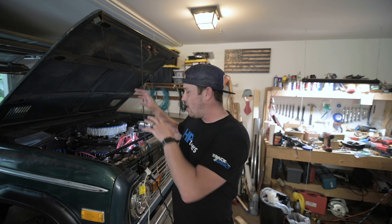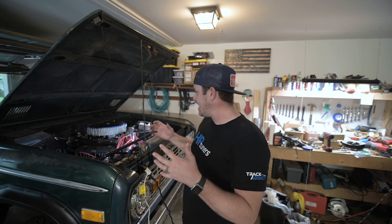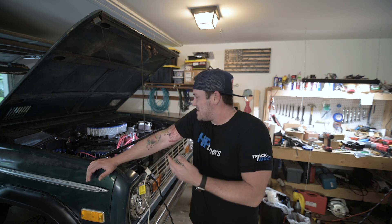There are a couple of interesting things going on. One thing I can't control with the fan shroud is that I'm blocking airflow on the passenger side — those headers aren't getting any air, likely because my heater hoses are blocking the airflow that should be moving past there. That's something to fix, but the fan shroud won't help that. Other than that, the driver's side just gets more air, and I'm not sure the fan shroud will change that.